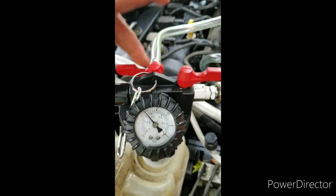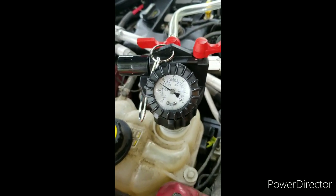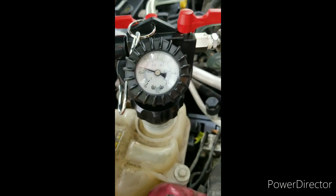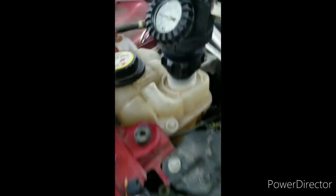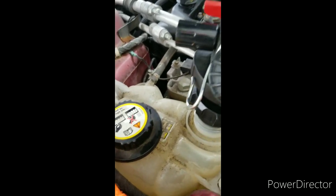So this one here has to be completely shut off, and I'm pulling a vacuum now. It started off at zero and as soon as I turned this, it jumped — and now I'm at negative 25. If I look at my coolant, you can see my main hose to my radiator is actually collapsing because of that. It's holding steady at 25 right now. So what I'm going to do now is suck the air off and see if it holds that.